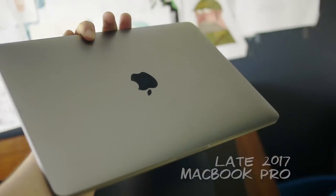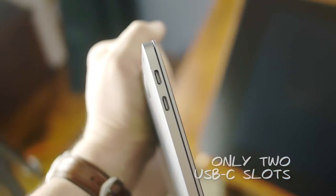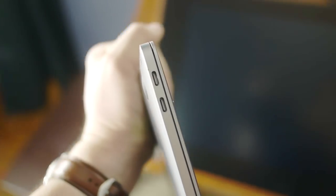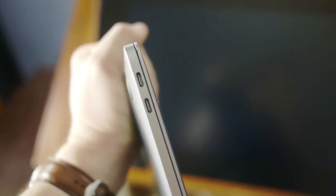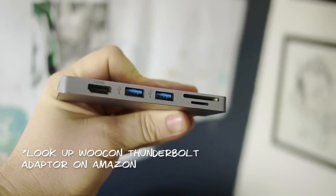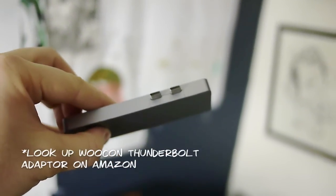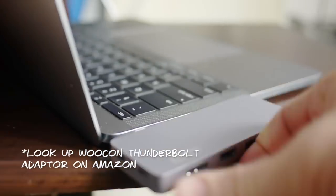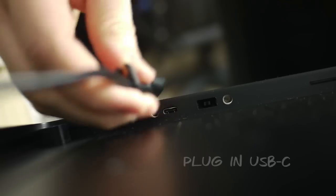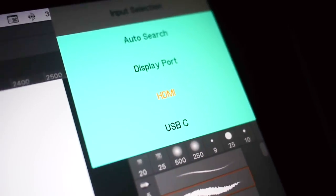I have a late 2017 MacBook Pro, which means you only have those two USB-C slots on the side — but that's all you actually need. You can plug the Cintiq straight into one USB-C slot and the power into the other. The Cintiq has USB ports and an SD card slot on the side as well as an audio jack, so you don't really lose ports by filling both slots. If you have an older MacBook Pro you can plug in using HDMI and USB, or use a Wukon Thunderbolt adapter from Amazon — that plugs into the two USB-C ports and gives you HDMI, two USBs, and an SD card. But I'm just going to plug in normally with USB-C, select the source, and it shows the image.